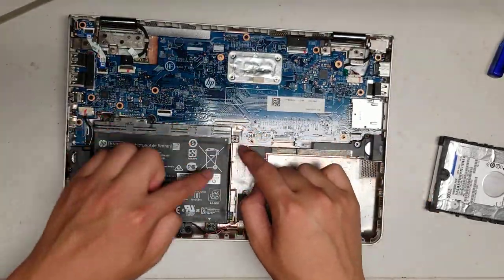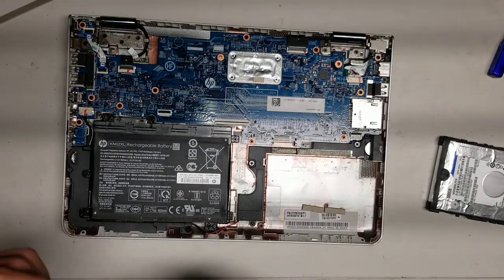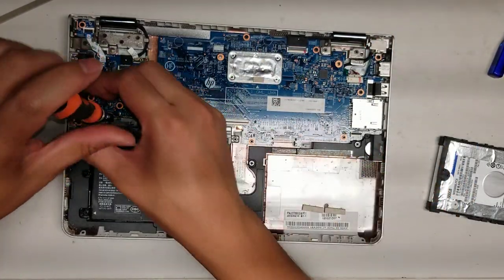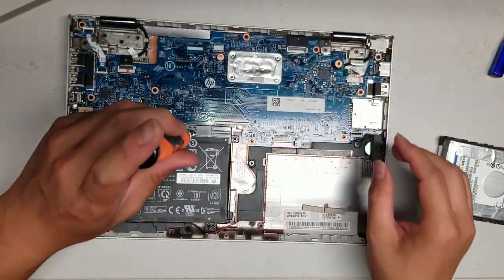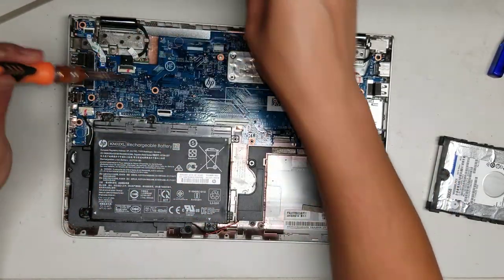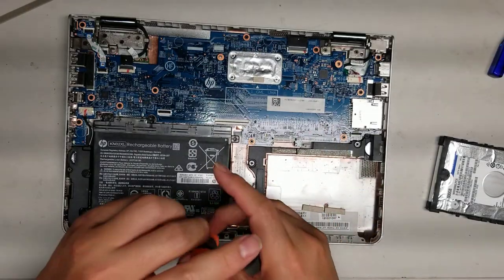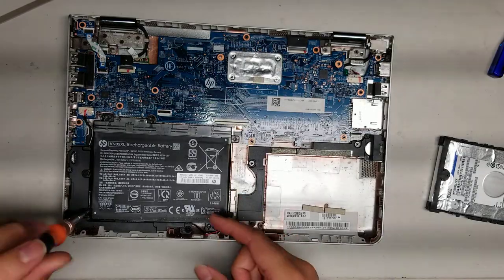You've got the battery here. The battery comes out by just taking the screws out and it lifts straight up. When you deal with anything like the LCD connectors, you want to remove the battery and hold the power button to drain any residual power. I've had people try and just pull that connector out and they fry their screen or the backlight circuits, and then their screens won't turn on anymore. It's an expensive repair to have the board circuit repaired, and sometimes it'll even damage the screen. So just be careful when you do that.